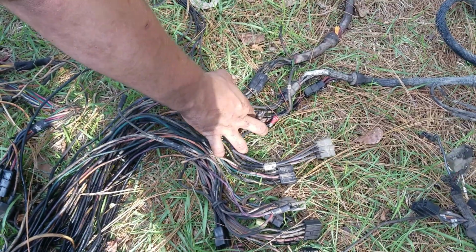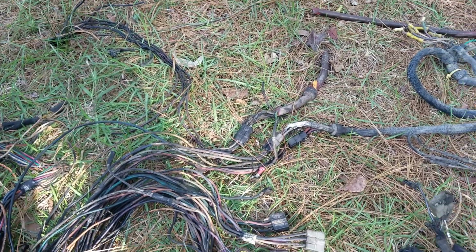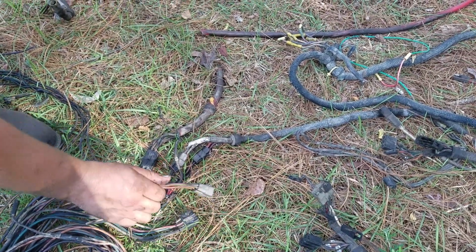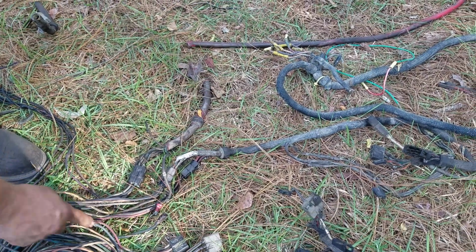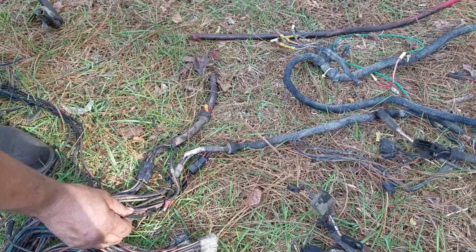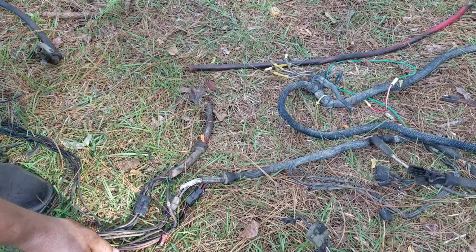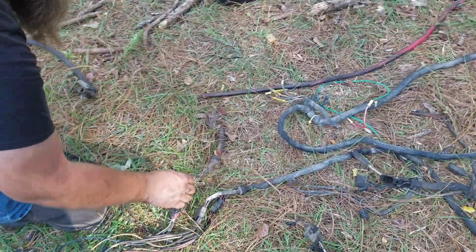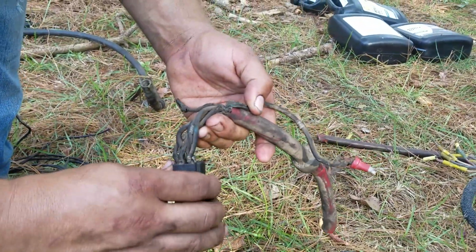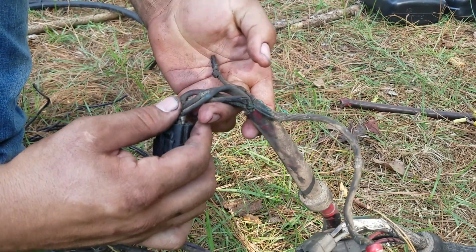And this is a Band-Aid. Oh, for sure. That's a Band-Aid wire on top of another Band-Aid wire on top of another Band-Aid wire, where they either cut the bad wire and then ran another wire from all the way back by the circuit breakers, and then it burned up. So just the high load of everything and not using relays, and everything goes to the circuit breaker. Like, look, this is the trailer harness, and that is a mess. I can't reuse any of that.